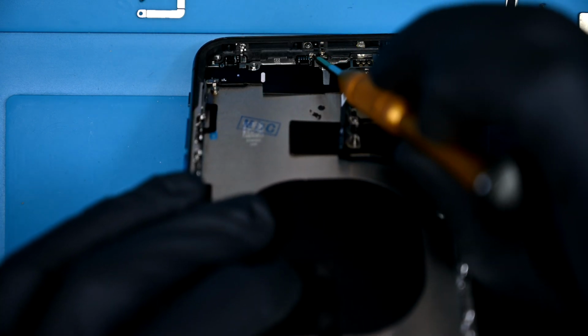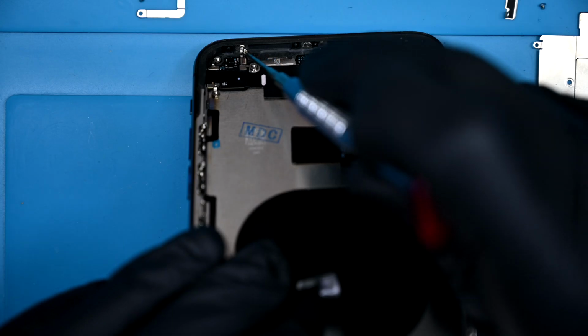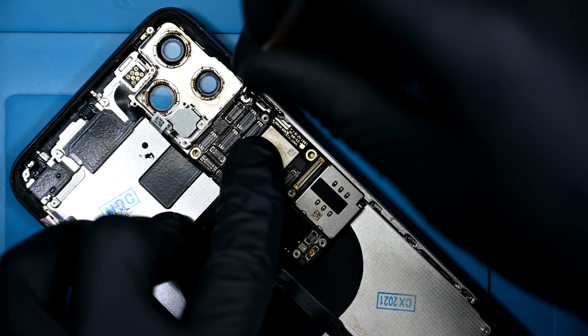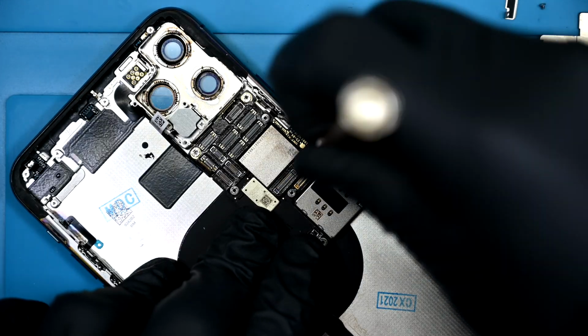I'll then replace the peculiar pair of the tri-wing and Phillips head screws to the top of the housing. You get the idea. I'm going to skip the next step. Dropping the logic board in, we've got those 3 standoff screws to tighten in. Make sure your hand doesn't slip if using a flathead. Board work costs extra.